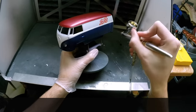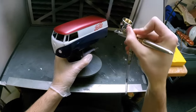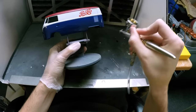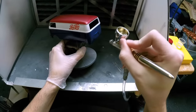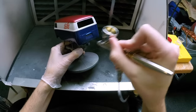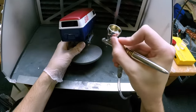In this first coat, I'm not going to hammer on the clear — I'm going to start slow and add a sort of tack coat for the second and third coat to stick to and bite onto. This also helps seal the decal in, because sometimes if you just hammer the clear onto the decals it could still be moving, warping, shrinking, and cracking the clear. By slowly building it up, you're not attacking it all at once and it has more time to breathe in the clear and adhere to it.